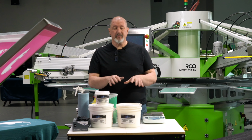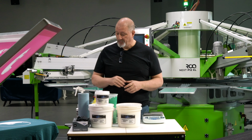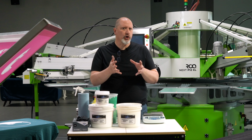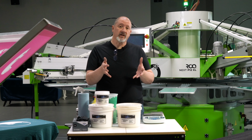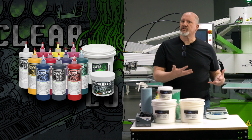So if you're using pure pigments, awesome. That's definitely a learned skill. For what we're going to do today, we're going to be using the fusion pigments. And these are more like color concentrates. So what's the difference between a color concentrate and a pure pigment? Color concentrate is something that's a little bit more user-friendly. In terms of the fusion pigments, they're about 1/3 pigment, and then the other 2/3 is, in our case, a clear core base. So if you're looking at the Green Galaxy mixing system, it's the HSA clear that we add our pigments into. So it's a high concentration dispersion.